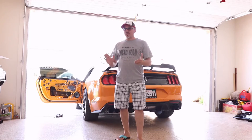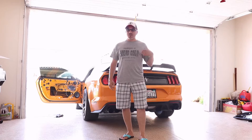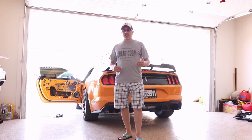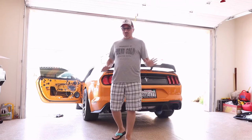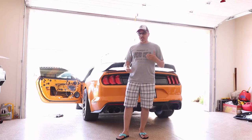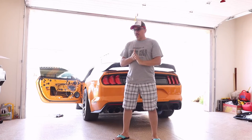While that's drying, I figured I'd give an update on the plan with the Mustang. Basically, I'm going to be getting a bigger turbo kit — a custom-built turbo installation. I've been trying to narrow it down over the last couple of weeks. At first I was thinking NX2, but with an NX2 you're limited in the higher range power I'd like to achieve. My goal for this car is definitely to get it above 600, maybe 650 wheel horsepower. I definitely want to get into the drag racing scene more, getting into the 10s — possibly even the 9s — in which case I'll need a roll cage, maybe a parachute. But for right now my goal is just to get into the 10s. I've been looking at the BorgWarner EFR kit — you can get it from Full Race, Function and Performance, and CPE also sells a kit.